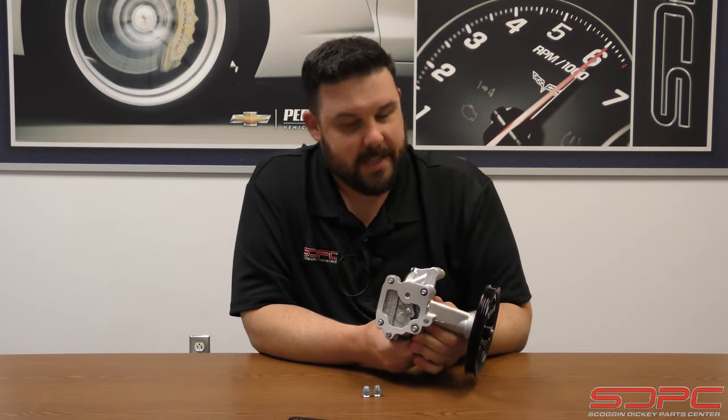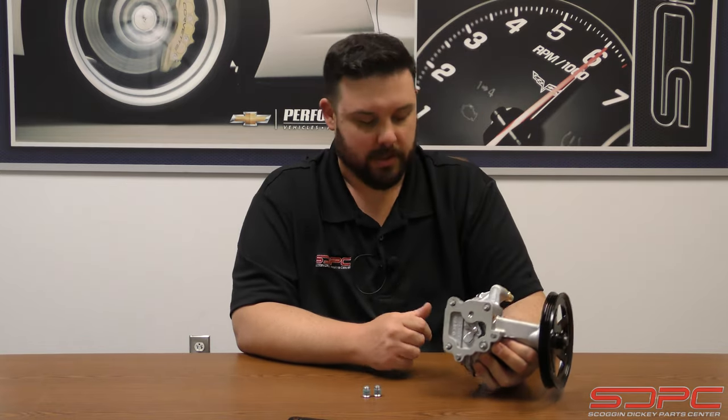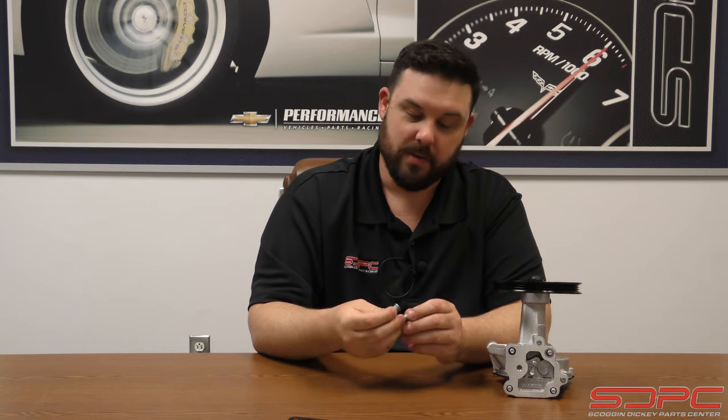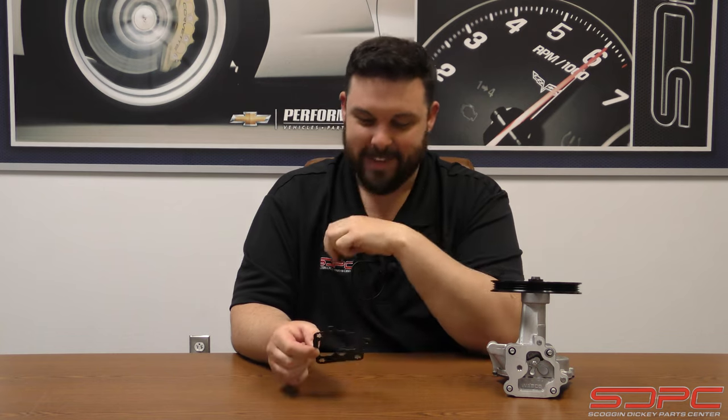But it's not so simple yet. There are two oil ports that feed this thing. This is a lubricated setup, and even though no oil was supposed to get into where this fitting was — even though that's what the TSB was for — it did. You need to plug those off. And that is what these two little plugs are here for. GM actually does supply these, and we get them right here in our warehouse. They come pre-sealed and are designed to go into those oil ports. The upper port is the oil feed and the lower port is the oil return. This is really what you need to seal these up. A lot of people think they need to find a block-off plate to put on there — not at all. If you put a plate on there with no plugs, you'll have an internal oil pressure leak that you can't solve until you put these plugs in. If you put these plugs in, you don't need a plate. There's nothing wrong with that space being exposed to air, weather, or heat — it doesn't do anything. So nothing to worry about there.